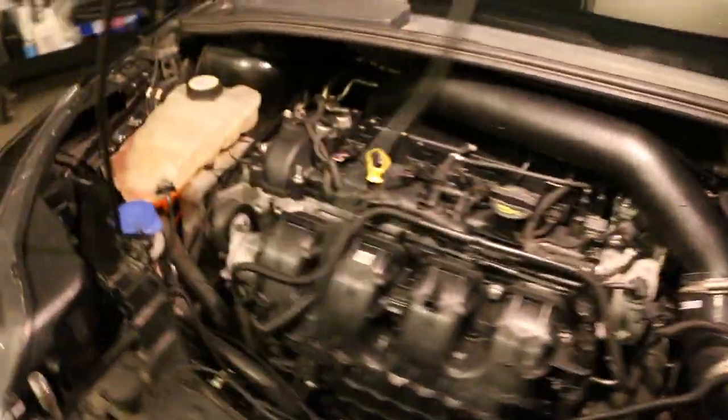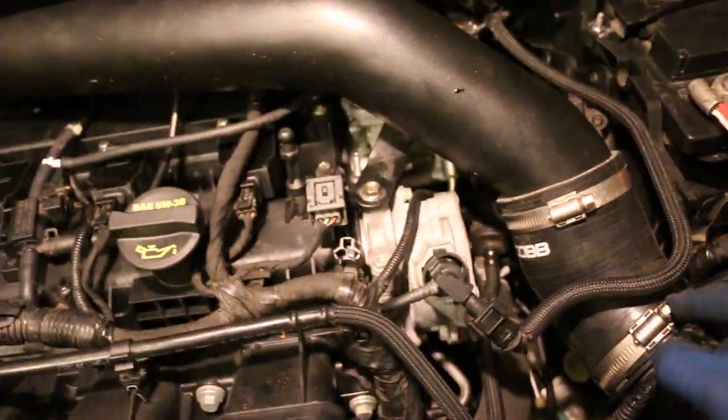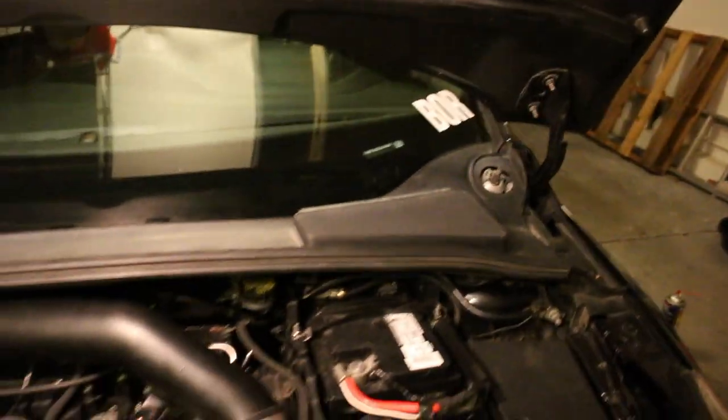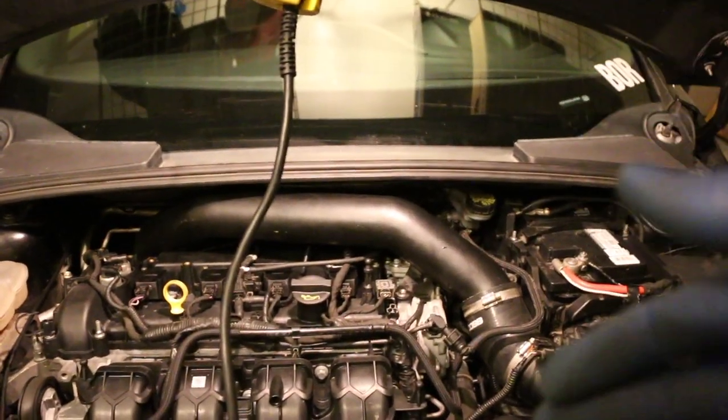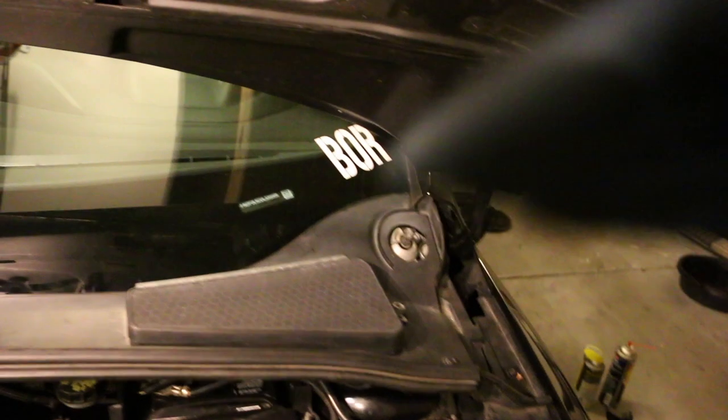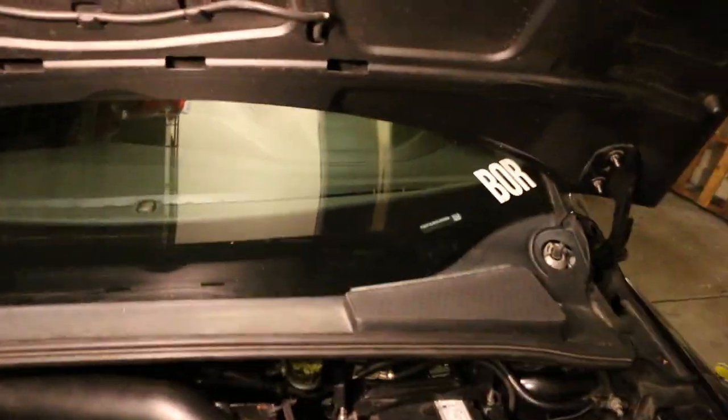The car is on the ground, everything's back in its home, laser tight, everything's plugged in, clamps are tight, everything's good to go, everything's routed correctly. When it comes to the wipers — I've always had a hard time before I learned this: before you put them on, actually turn the car on and hit the wiper lever, have them run a cycle of up and down so that the posts themselves are in the correct position. That way it's going to be flat when you put them on both sides, and it won't get all wacky when you use the wipers.